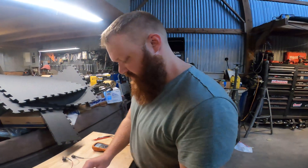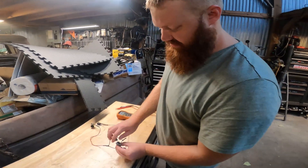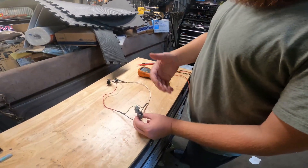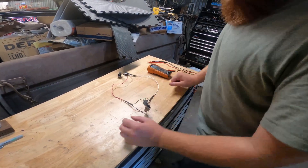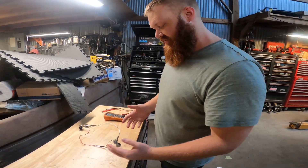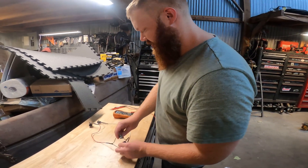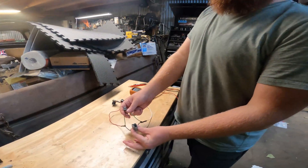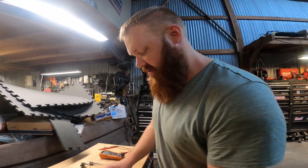So what have we done here? Same as the original setup we had, the goal here is to create additional resistance across these pins. These pins connect to the thermistor that goes to the EVAP, which is basically just a resistor that changes its value based on the temperature. And by adding resistance here, we're essentially modifying the value of the resistance off the thermistor so that way we can trick it into going a little bit lower. The reason this looks all crazy is the goal here is to get this to just click right in without cutting any OEM connections.